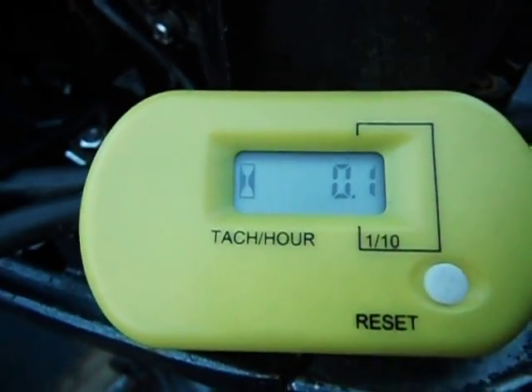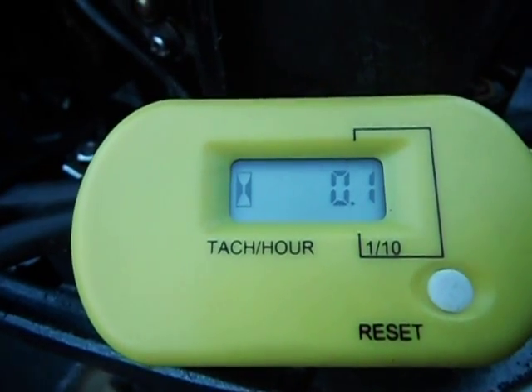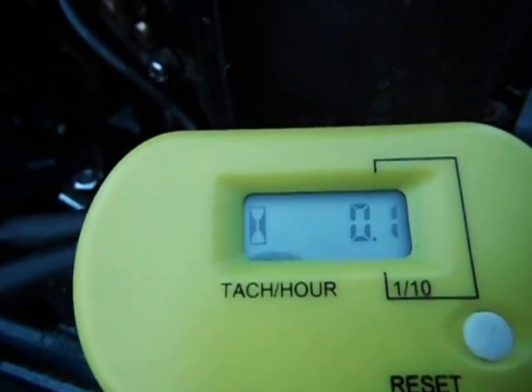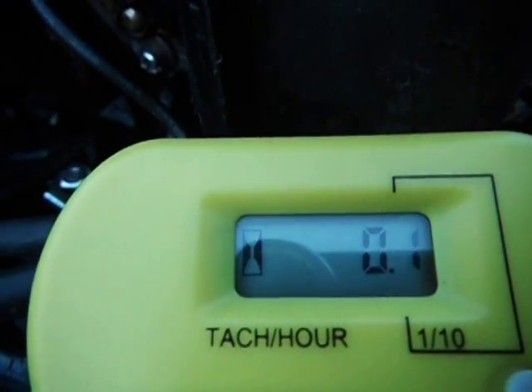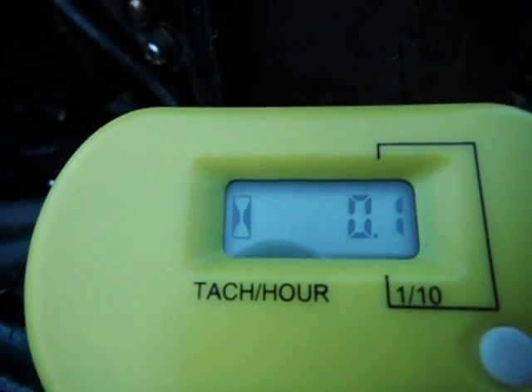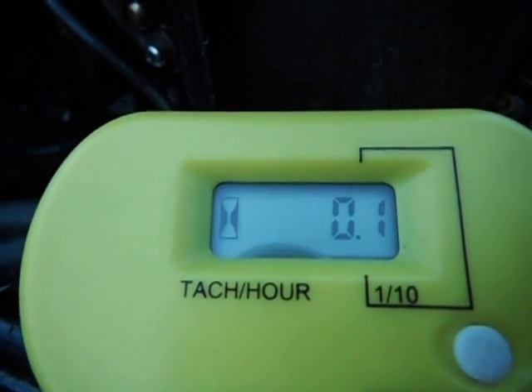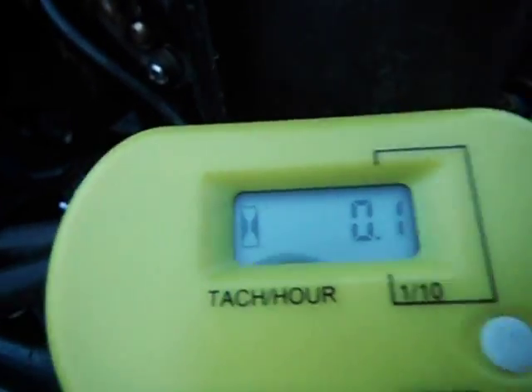Release the button and it will reset. I'll start the engine again. Once it's past the hot start phase, we want it to show about a thousand revs. I'll rev the engine up to around three thousand revs, and then I'll show you the rev recall feature — when you turn the key off, it will display the maximum revs from that session for five seconds.